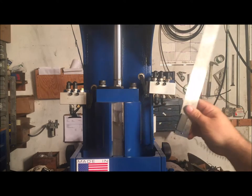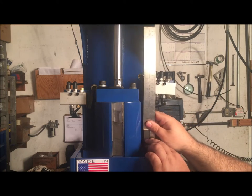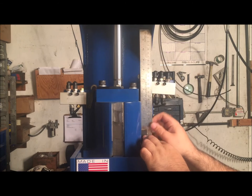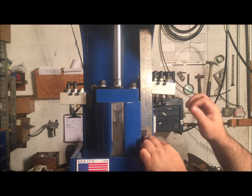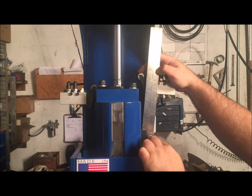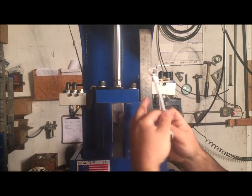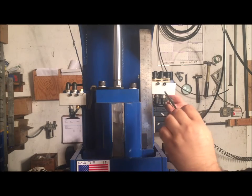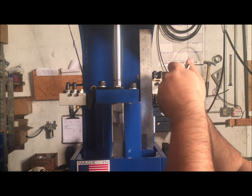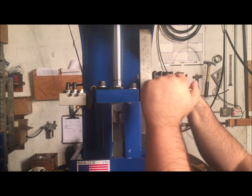At this point, you should be able to observe the location of the center of the wheel on the mini-valve — it should be directly in line with the straight edge of the ruler. If it is, then your mini-valve is adjusted correctly. If it is not, loosen the two bolts that hold the body of the valve in place and reposition it so that the arm is in the correct spot, then tighten the bolts back down. There is no torque specification on the bolts for these valves and they do not require Loctite.